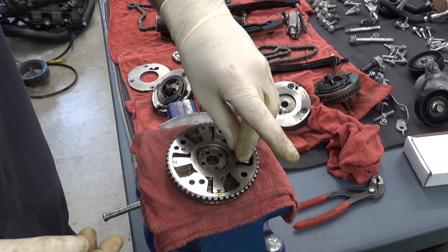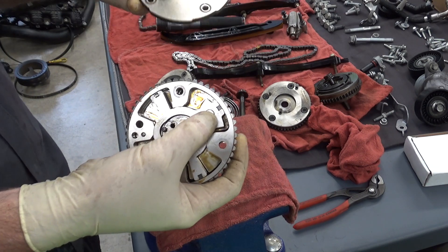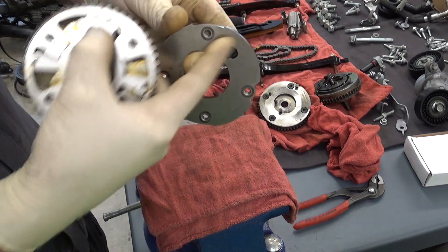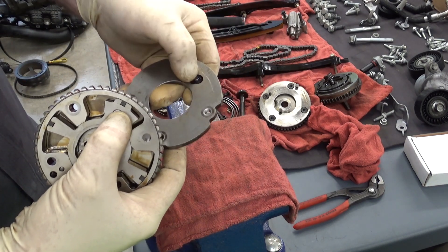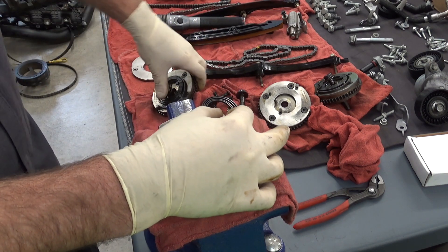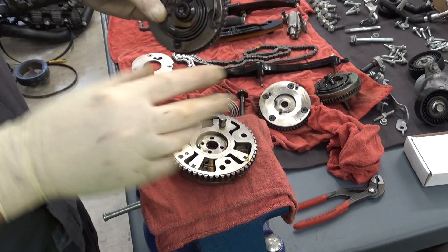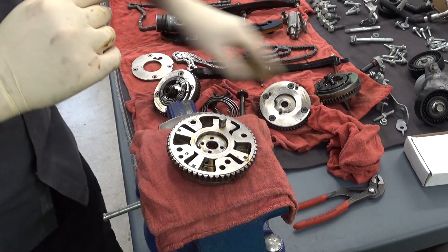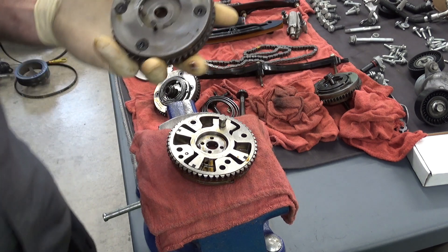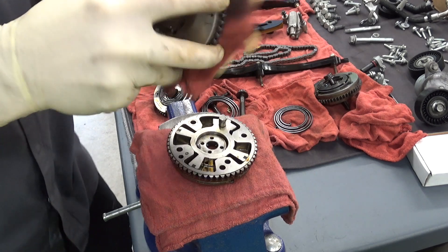That is the problem — it's not an oil pressure issue. It's this little plunger that does not engage in the slot, and there is wear in it. So that's what the updated ones address — hopefully Ford has done something different so it can lock them. Both exhausts were fine, they were locked, but the recall is replacing all four of them. This other intake also was unlocked before I took it out of the vehicle.